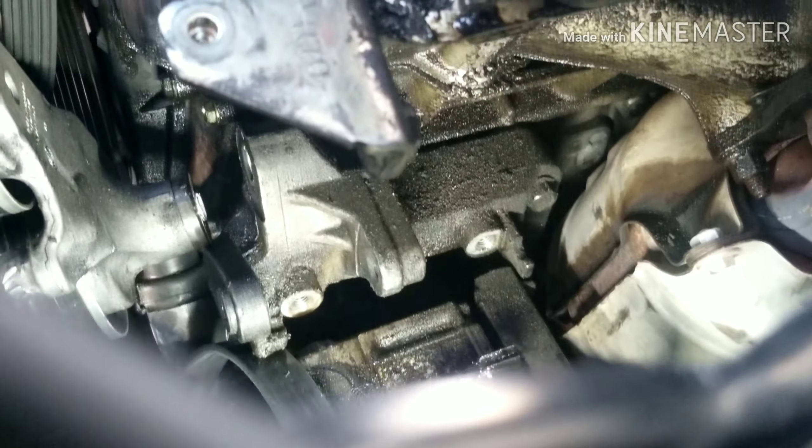Any questions or comments, please subscribe, chat, and share this with the world. I'm going to put this back in the car now. I wanted to give you an overview of what this thing looks like — inside the car it sits like that, and the shock makes this thing pivot to keep tension on the belt. If that bolt breaks, that's just metal fatigue over time. This car is a 2010, so it's about 10 years old. I'm not going to film putting it back together — looks like we've got some bad weather coming and it's Friday night.